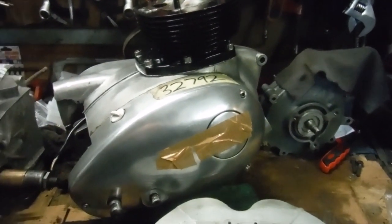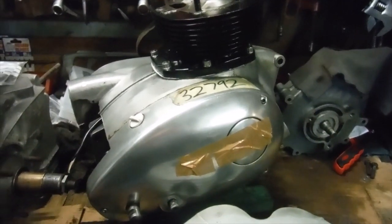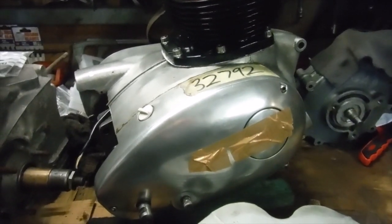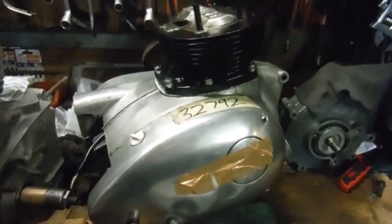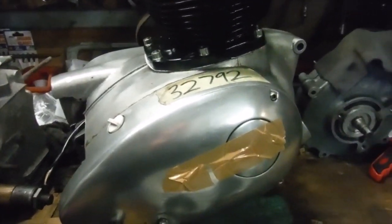The bottom end of the jigsaw quality street tub A65 engine is back together now, apart from the primary cover which I haven't fitted because I'll probably still wish to turn the engine by hand - I can put a spanner on the end of the alternator to do that. Other than that, all that lot is back together and ready to go. I'm going to move on to the cylinder head next.